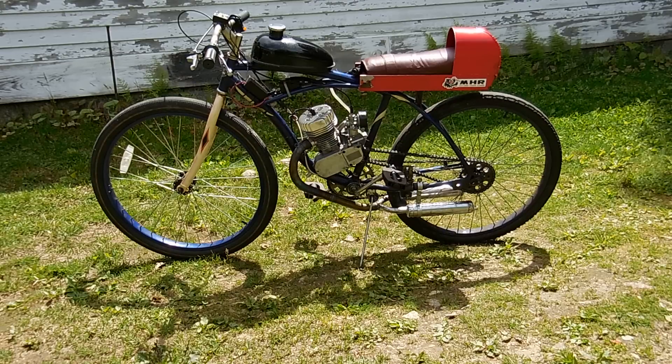I was thinking about the stock exhaust — what you see right there is not the stock exhaust, but it is a more free-flowing system. According to my testing, I tested the stock exhaust as well as this exhaust and I actually got a five mile an hour increase in speed just from the reduced restriction that this twin exhaust system offers.